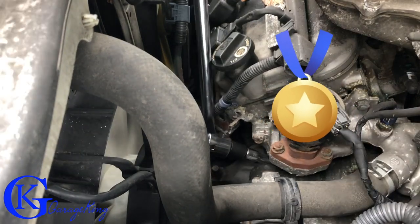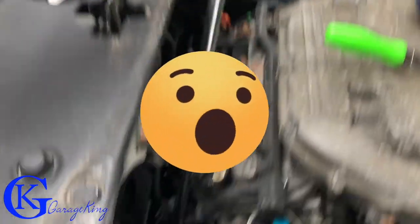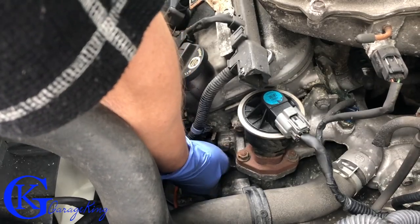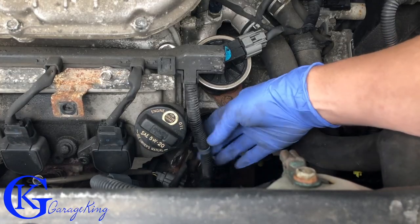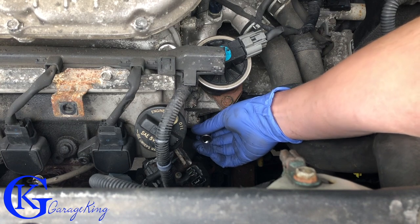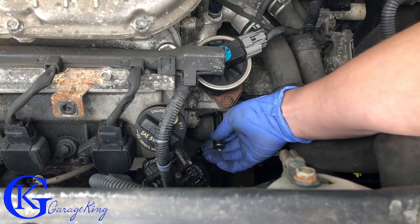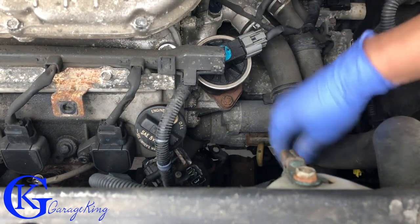I got out the breaker bar — a nice long bar — to see if we can get the top bolt out. There we go, it's moving, it's loose. That top bolt was really, really tight. Just to give you an idea, it's a long breaker bar. Now I'm just going to take out this top bolt. There is a shim between the starter and the block, and that's going to be the tricky part — I'll show you a trick to handle that later.